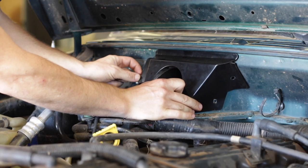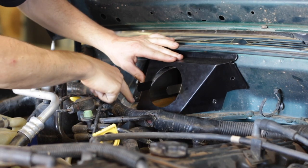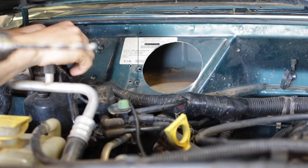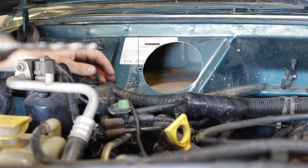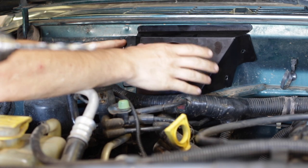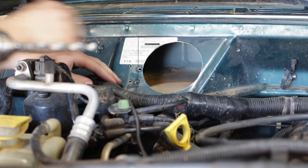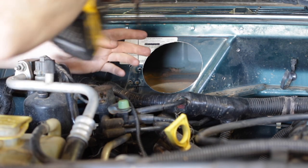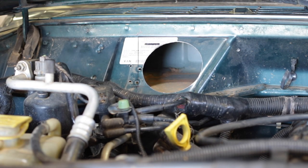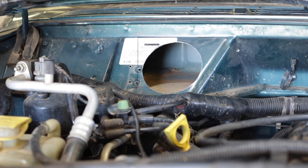So what I'm going to do is put this back lined up here where the holes are, and then just with the sharpie mark a few points here to represent my maximum potential opening. I just went and traced the inside of this bracket. That sharpie represents the most that I'm willing to cut out of here, and the bracket will still be able to cover this and you won't be able to see anything. A trick for getting these corners real nice is to take a drill bit and drill some nice large holes before you cut. I'll start with a quarter inch and then go to three-eighths, then take a zip wheel and connect my holes and I'll end up with some rounded corners.